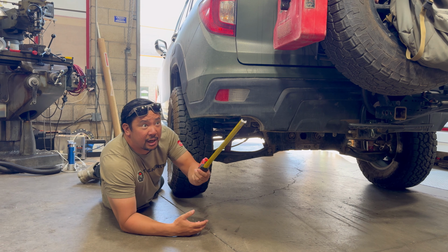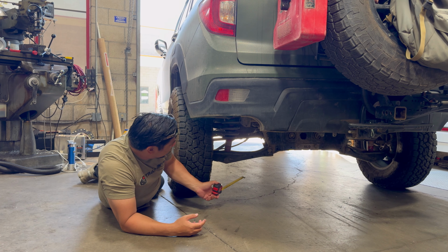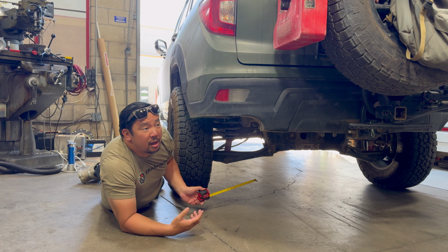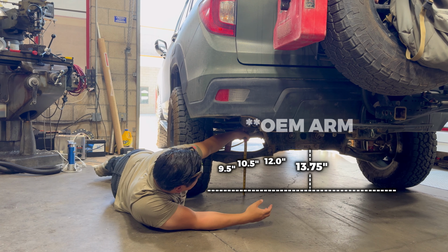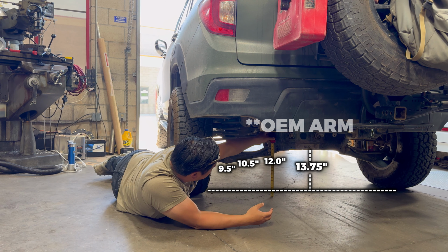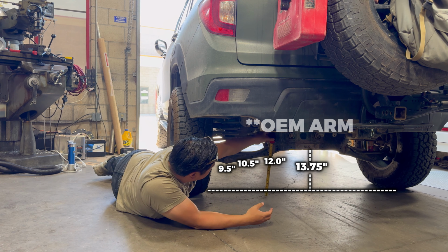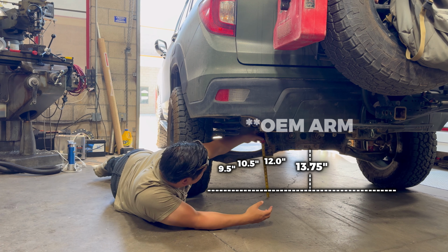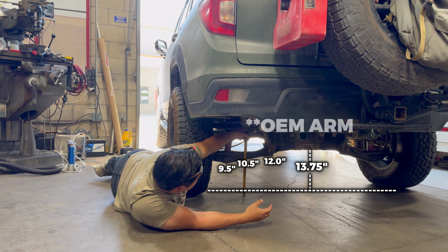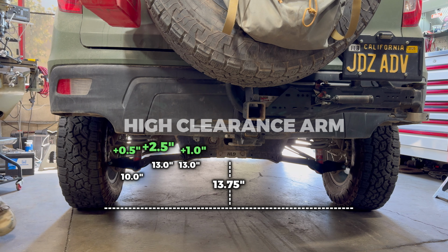These high clearance lower control arms are gonna open up this clearance right here. This is still gonna stay the same, give or take. It might be worse, it might be... no, looking at it, you're gonna have more clearance down there too. Okay. And Manny's right, we actually gain 1/2 inch, and it would have been a whole inch if I didn't have a Toyota TRD shock. So for people that are running OEM shocks, most of you are, then you will gain an entire inch at the lowest point. The most gain you'll get is a whopping 2.5 inches.